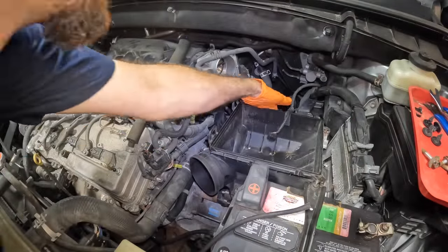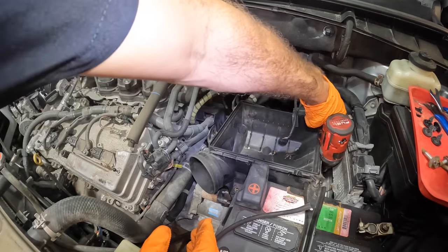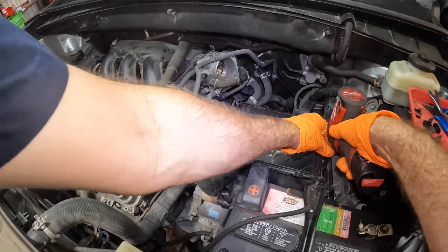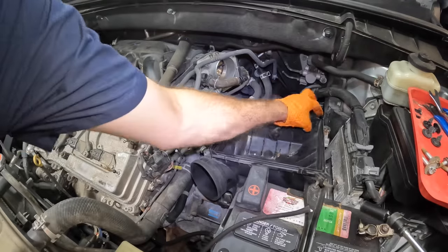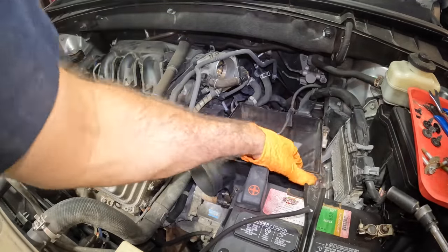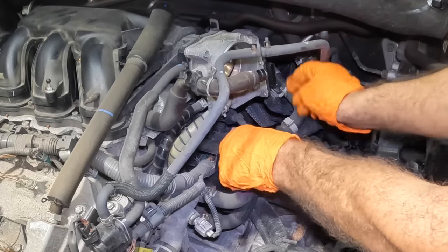There's our filter unit, and there might be another bolt back there. One right here, I see it. We see you, yet I couldn't reach it. Okay, is there another one? Another? Maybe? No, just a rubber grommet. There we go. Okay, let's disconnect our throttle body connector here, because I'm gonna have to pull the throttle body